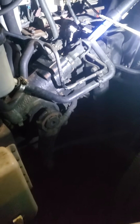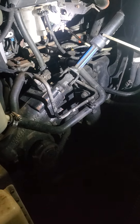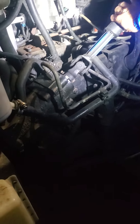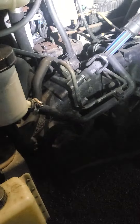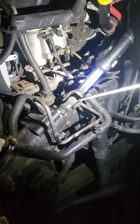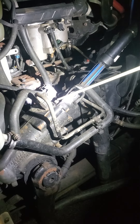I will now check the steering components. Steering shaft — secure, no crack or broken. If I twist it, it should not play more than 10 degrees. Lower and upper universal joints — both secure, no crack or broken, properly greased, and the bolts and nuts are present and tight, not loose or missing.